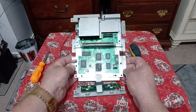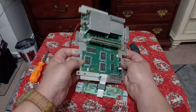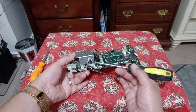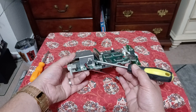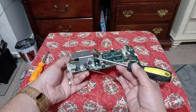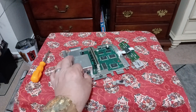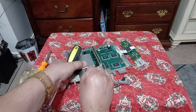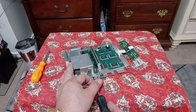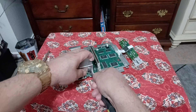Now you've got your board out. We'll need to take some more screws to remove this heat sink. Over here is the power regulator — I've changed this out for an up-to-date one and apparently it doesn't get hot, so the heat sink isn't strictly needed, but I left it for the look. Pull the power cable out carefully and then take the screw for the voltage regulator.